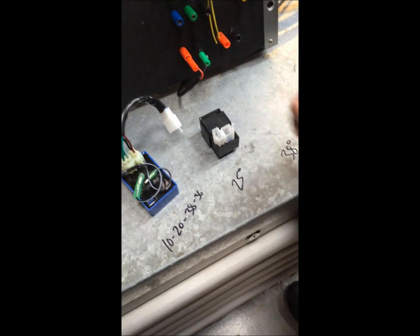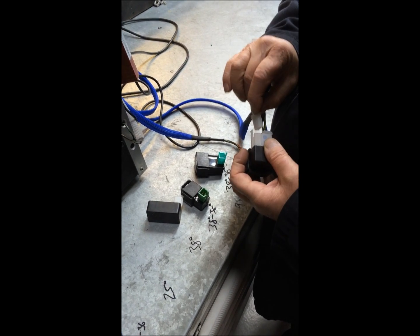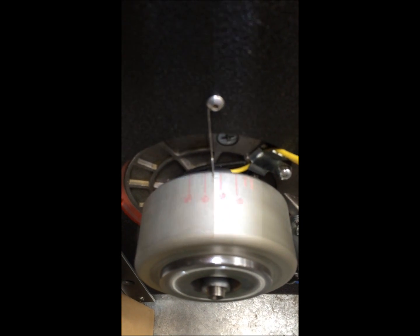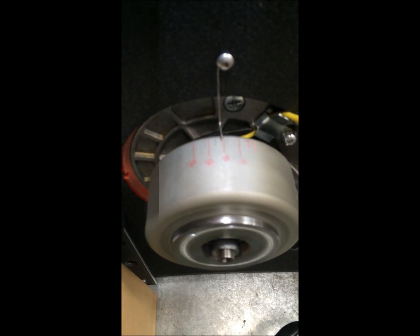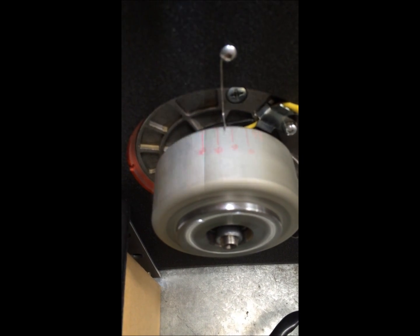Bill, can you plug in the six pin? This is like the common one found on a lot of the Aces and Apes, etc. So, six pin Chinese — let's give it a go. Look at that, it is advancing, but only to 25 degrees. It starts at 20 and wraps to about 25. But it also has a glitch if you watch — it jumps there, and again on the way down. Right there. Not much good in the real world.